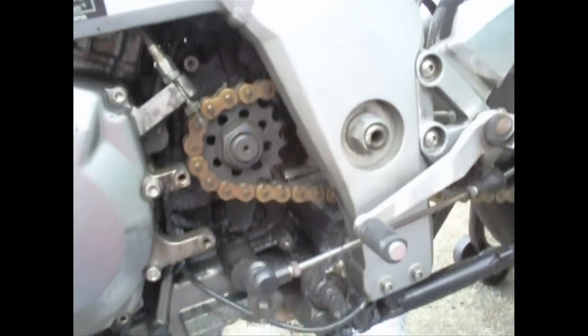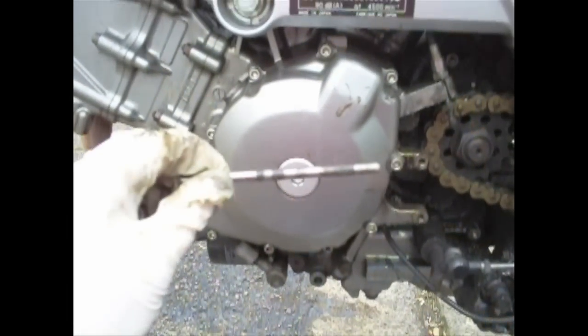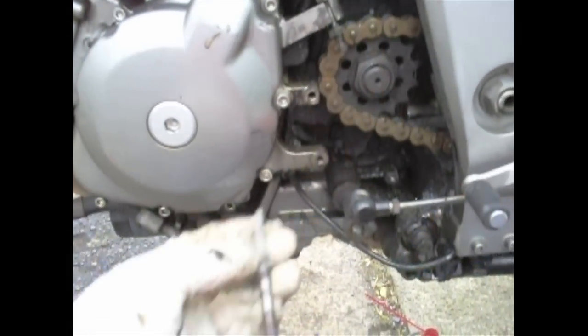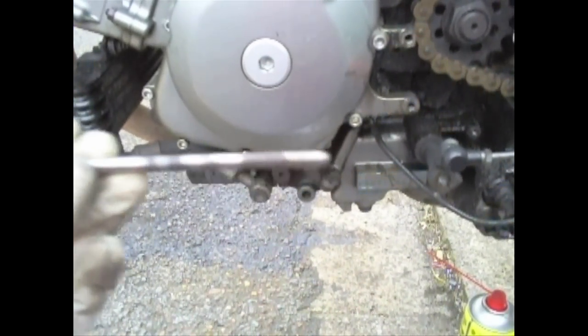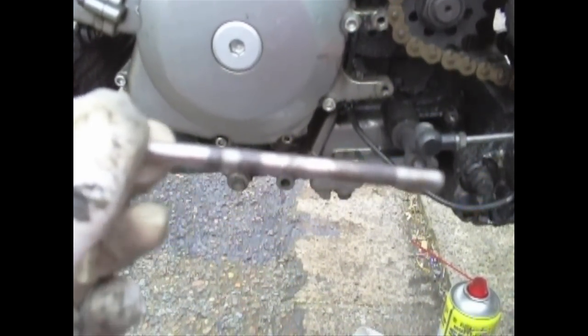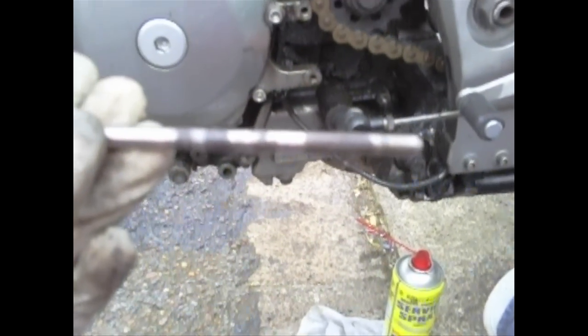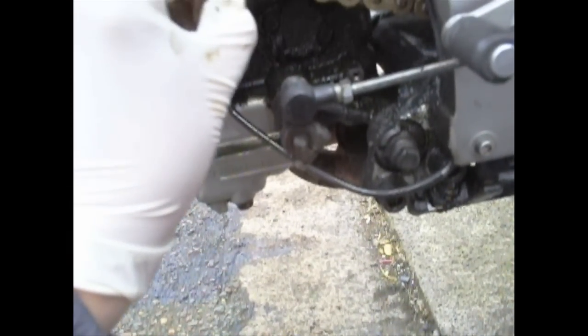You can see there are some rather nasty rusty segments on the push rod. It goes in there — technically that way — and you can tell a nice clean end. This is the bit that disengages the clutch, or separates the plates when you pull the lever. The worm gear pushes it into the engine like that. You can see it's got some build-up of corrosion, so I'm going to use a bit of wire wool to get that off. Now a good tip — if you haven't got wire wool, you can use the chin hair from a post-menopausal woman.